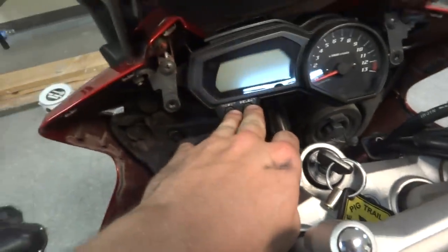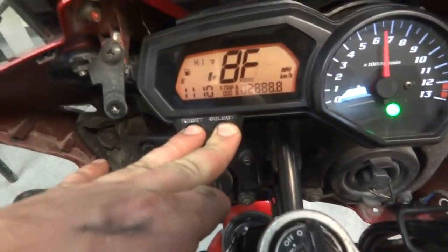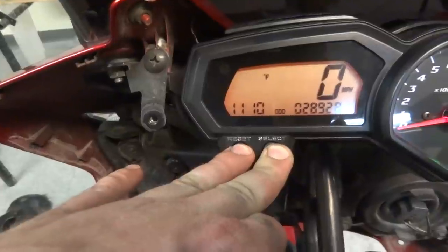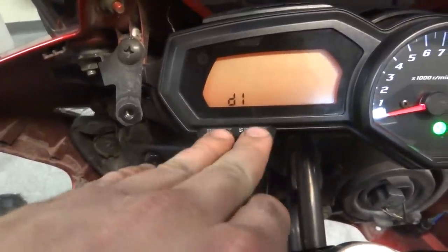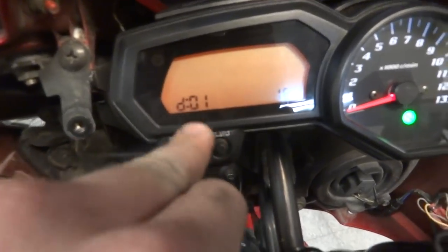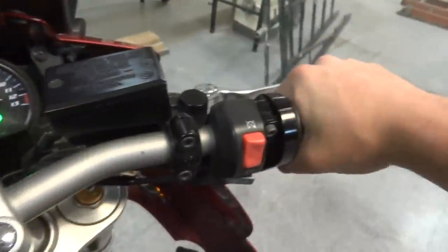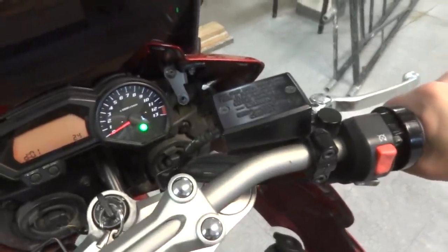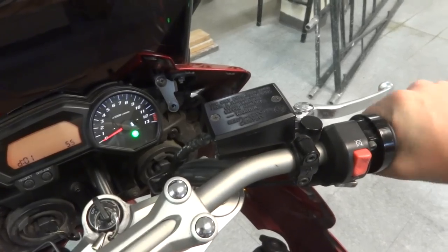So I'm going to put the camera down here. The clock comes up and I'm pushing both buttons. I turn on the key. Now it's going to pop up — D1, I think — after about 10 seconds, right there. So you release and press again, and then it should say D01. And here's your actual throttle position according to the sensor. If I turn the throttle, you can see that's reading the position.